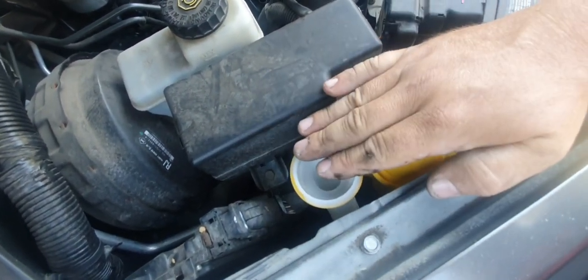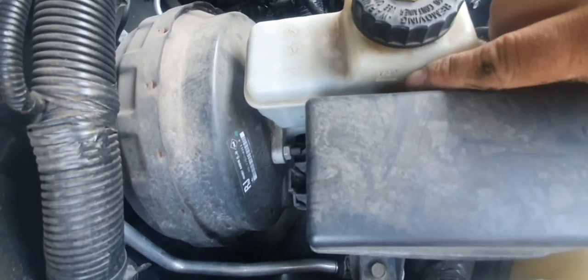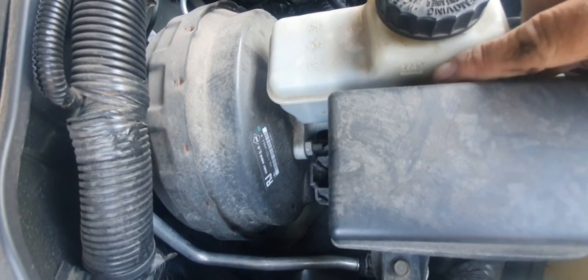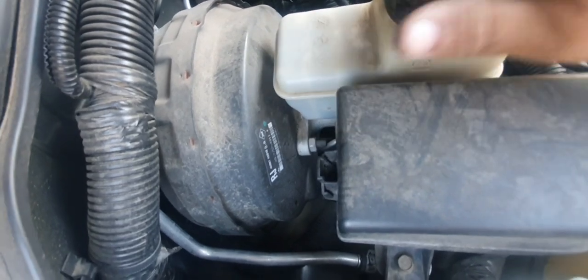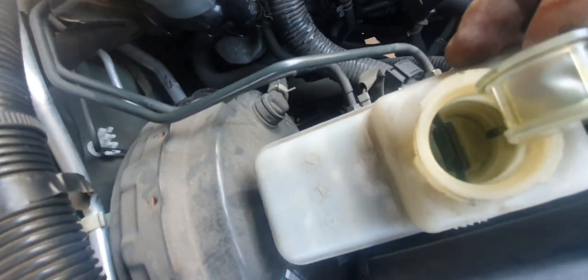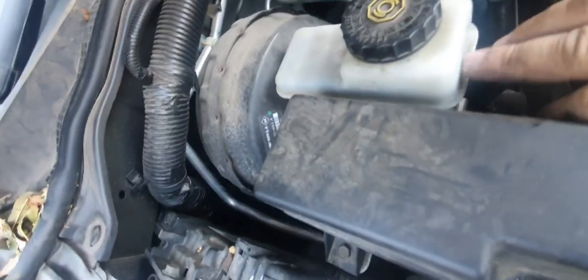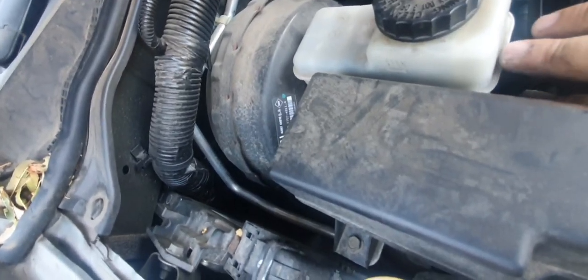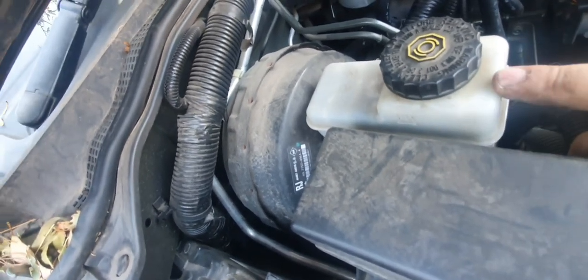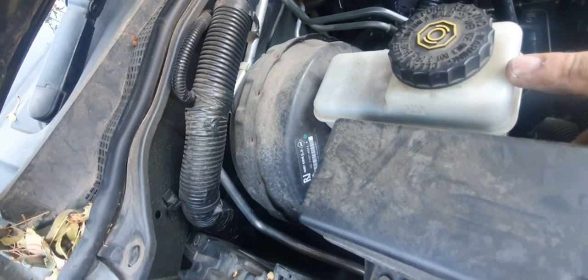That's our windscreen washers. Now, brake fluid. Might be able to see that. Most brake fluid reservoirs have got max or full or something along those lines cast into the plastic, and a low mark, or high, low. Just have a quick look. Your little strainer can come out. Sometimes it's a little bit difficult with the plastic to judge the height. That's getting on a little bit low, so I won't top it up. I'll go and have a look at the brakes, but that'll be when we finish up the oil change.